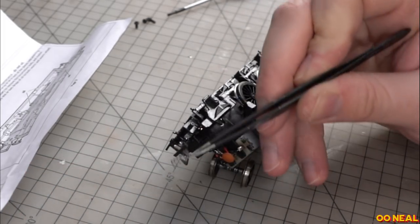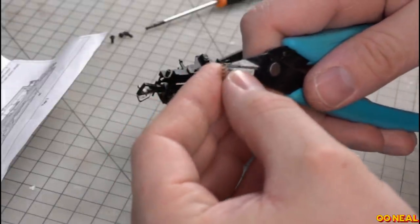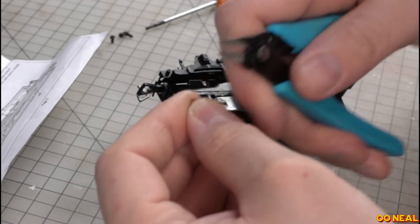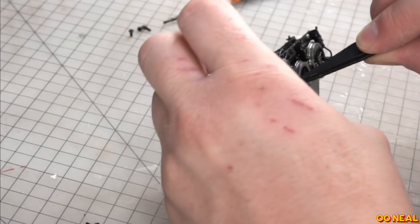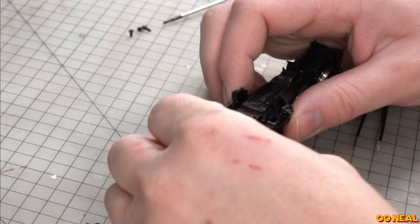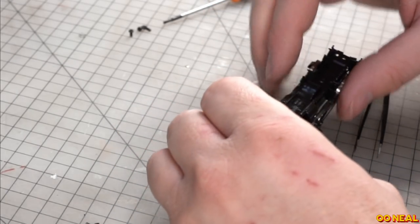I get the spring, and all I do is snip off a few of the coils to make it a bit shorter. It will naturally make it harder, but it's got less preload when it happens. So I give that a snip. I kind of mangle the ends of my clippers to do this, but they're my older set, so I thought this is fine. Anyway, I put it back in. If any of you pick one of these up, let me know if it's got the same issue.